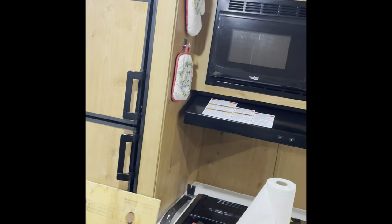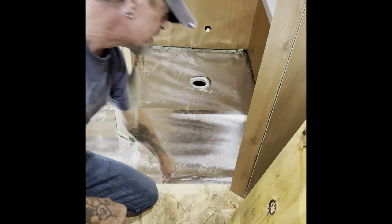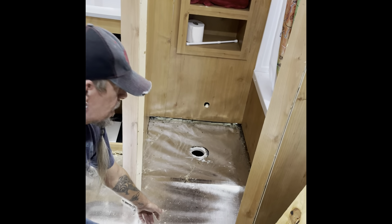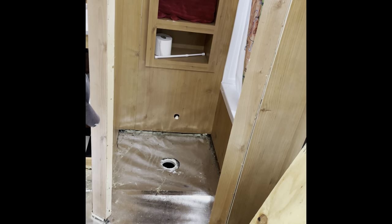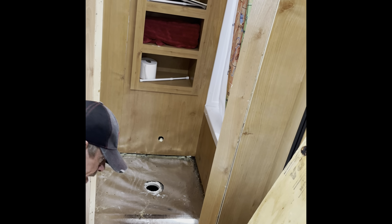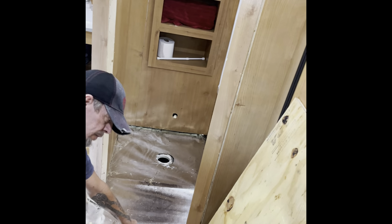You can see the bracing has already been installed under the unit. That's a piece of treated 2x4 that has been wrapped in the Tyvek material, which protects it from the elements. Everything was folded in, stapled and glued together, so everything's really sealed up. And it just worked out that the damage area landed very conveniently close to a rail that we could use for structural bracing underneath.